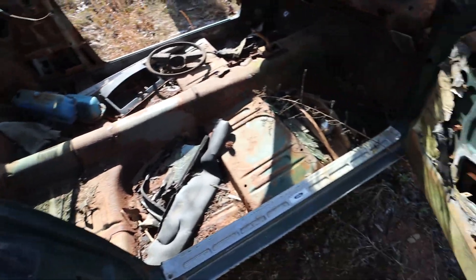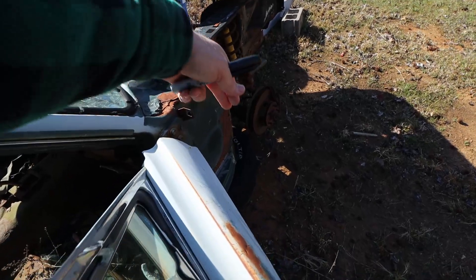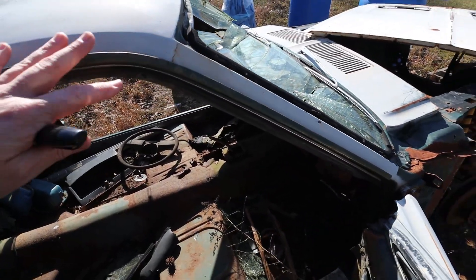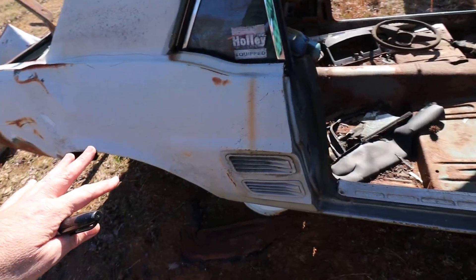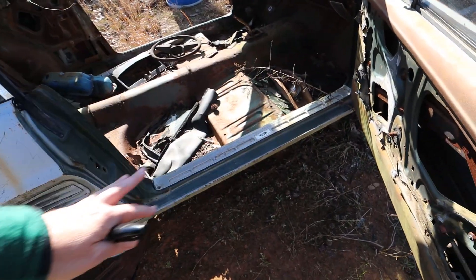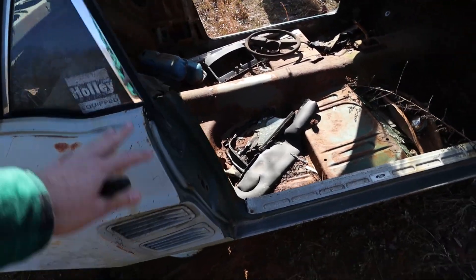In light of what I've just told you — the side toe kick panel, the outer rocker, the windshield frame — all is good. In that case I'm not going to cut all of this stuff out and install the full fastback rear quarter door assembly. So I'm going to cut this car a little differently based on that.